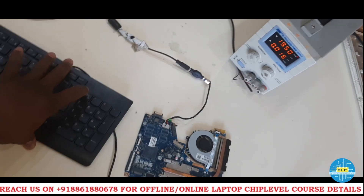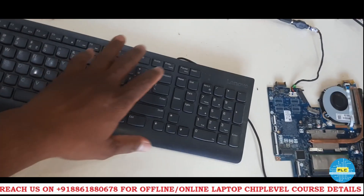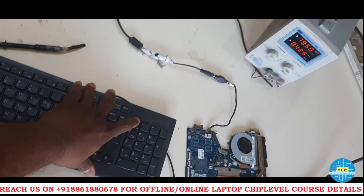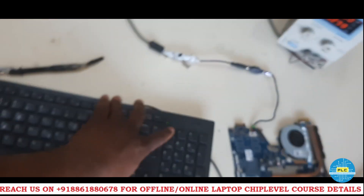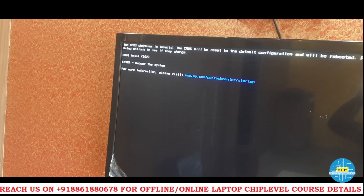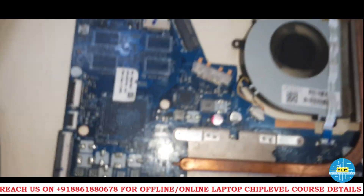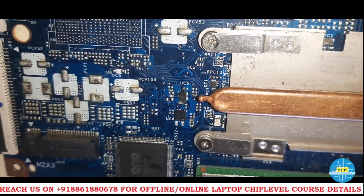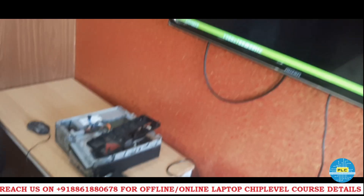Again, will it turn on? I will wait — otherwise manually I will turn it on. Let's turn it on again. What about the display? I am waiting for the display. See guys — the display came! What is showing? CMOS reset. Here, with the amp — here, without crystal. See here, it's YC2. Without the crystal, crystal is still removed — and you have still got the display.